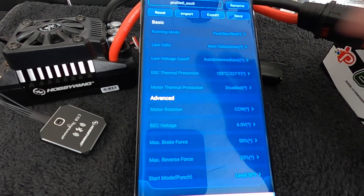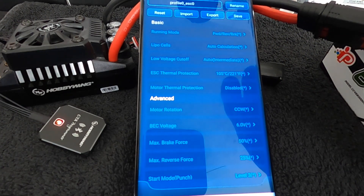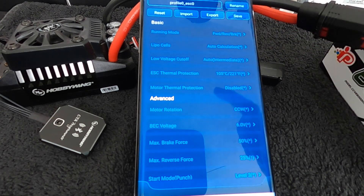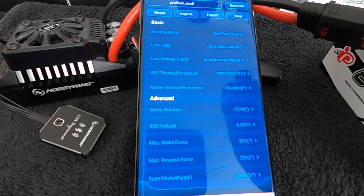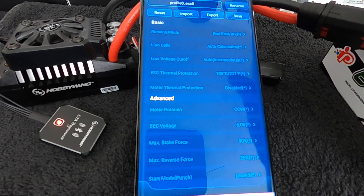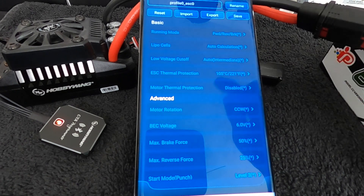With the voltage cutoff: if your vehicle has any sort of shutdowns, goes into limp mode, or does goofy things, and the batteries aren't dead when this starts happening, it's usually because of bad connections. You can adjust the LiPo cutoff to help deal with that. Dean's plugs, TRX plugs, EC-style tube solder plugs are real common to have issues because of the way the wire floats in the solder — you get a lot of goofy low-voltage shutdowns. The same thing can happen with low C-rated batteries. If I run packs under around 70C or not 100C packs, I can get goofy shutdowns before the battery's dead depending on how hard I drive it. You can also adjust the punch mode to help with that.